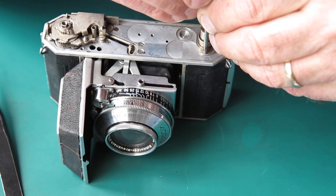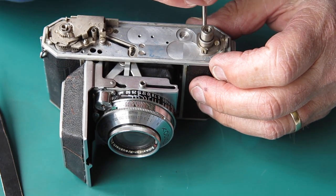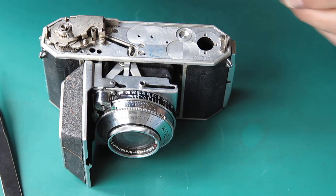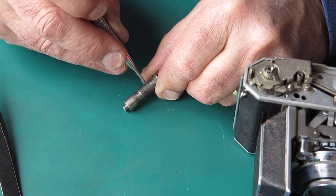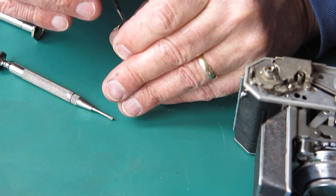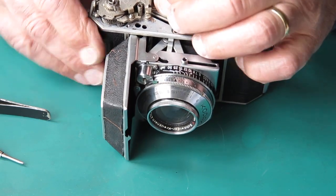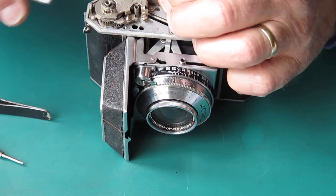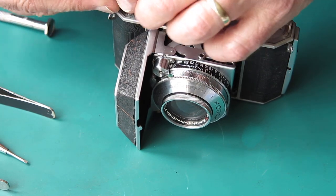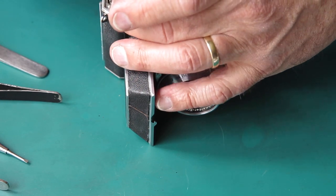Take the rewind off while we're here. This one has a screw that stops the inner and outer sections coming apart - quite sticky. I'll just cock the shutter, which I did by forcing the cocking rack across. Take the gear off the top there and I've just allowed the film advance to unspool.